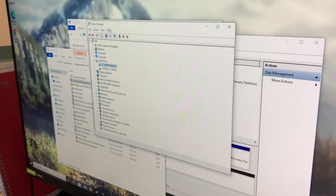There are a few more steps before you can start using the installed drive. I launched Device Manager and went to Disk Drives. It's fairly hard to see because of the resolution, but you can see the drive listed there — CT1000MX500SSD1. This shows that from a software standpoint, Windows can see the drive. I'll exit out of Device Manager.